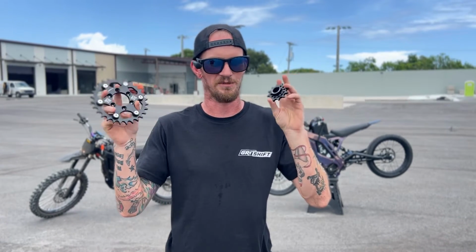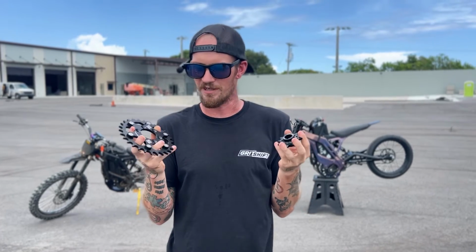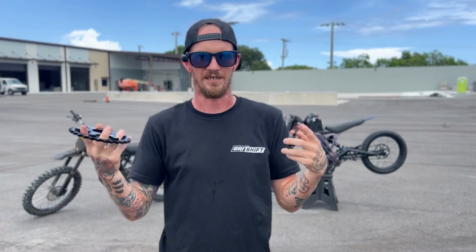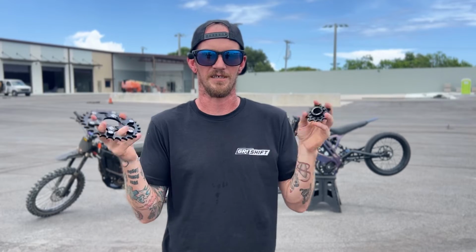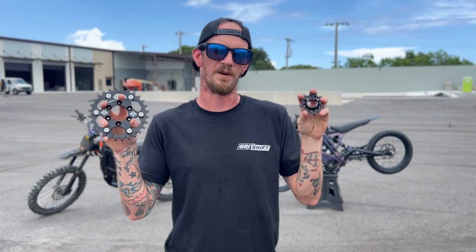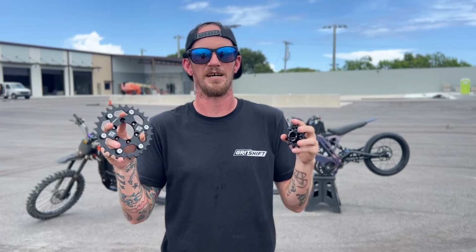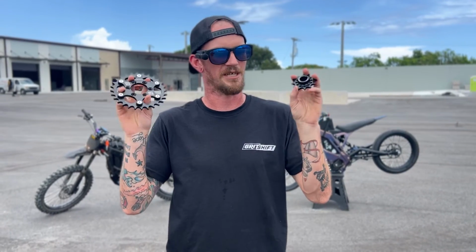Once again, aluminum sprockets front and rear, very light rotating mass. Our main point with these is we have designed these things around us. Really, that's it. These things are for us, which is also for you, because we ride the crap out of our bikes and we don't want to have to spend time fixing stuff. So, this kit right now, you should be able to put out more power than your jack shaft can handle and break your jack shaft, as seen on EBMX's race bikes, before these will break. So, lightweight aluminum, but you can't break them until you break the stock jack shaft.